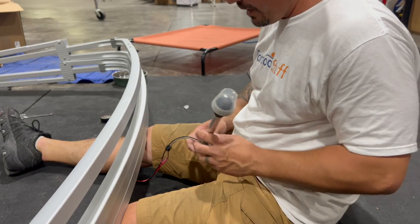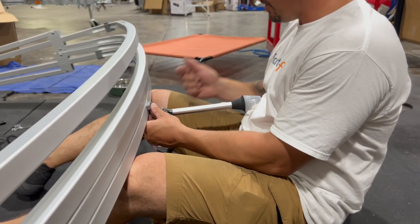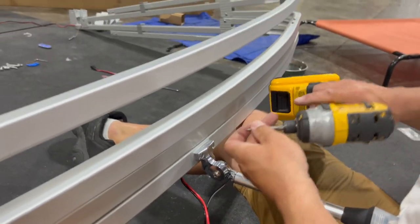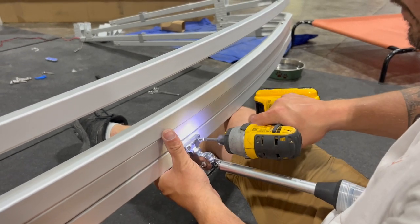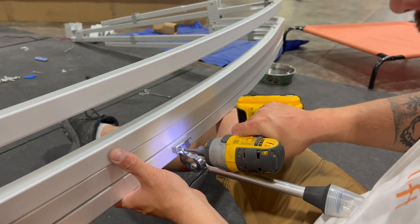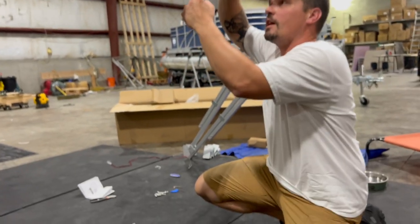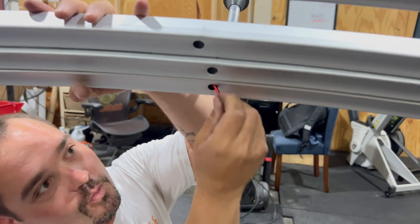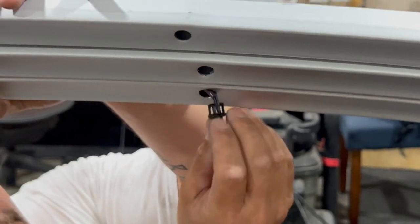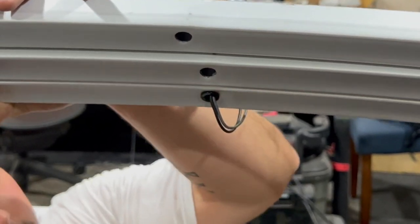With the wiring ready to go, I can now install my light into the top of the bimini frame. I'll line it up at the center the best I can, and these are just stainless self-tapping screws — I'm going to gently drive them in. Our light is installed. Looking at the underside, I'm going to push that red and black wire in all the way until those butt splices are in. Then I can use that black grommet and push it right in there — now my wires can't chafe on the aluminum square tube.